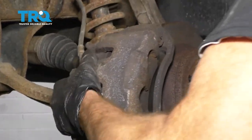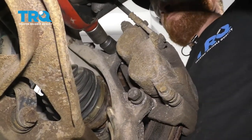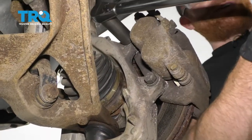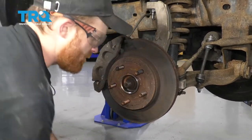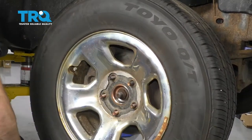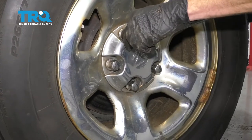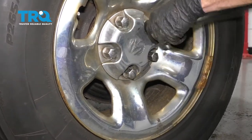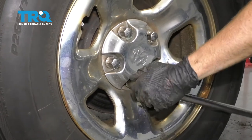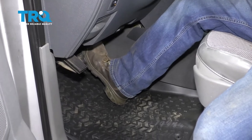Let's go ahead and start the caliper on there. Start in both of your bolts — it's a good idea to use a little bit of thread locker on these. Let's bottom these out and torque them to 138 foot-pounds. Now it's going to be time to get the wheel up on here. We're going to snug up the lug nuts and torque them to 130 foot-pounds. Go ahead and pump up that brake pedal. That feels good. So now at this point, what you want to do is take it for a road test and of course get it down to your local alignment shop.